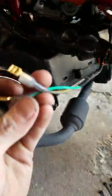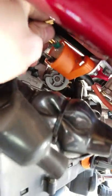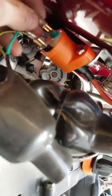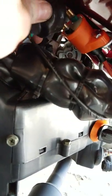Now with that fastened down, make sure the dust cover is over the wires. Go ahead and wrap the wires up in there — it'll just slide over. Green goes to green, and black and yellow go on the black terminal. Then slide those clear water covers over the connections, and slide the black cover over it as well.